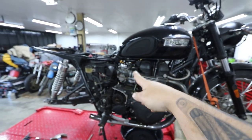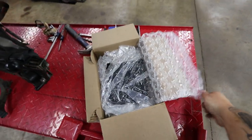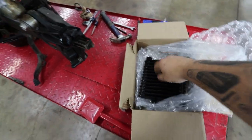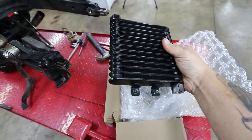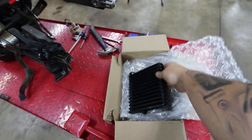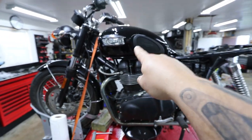I have to rip apart these carbs anyway. As I mentioned in a previous video, I sourced out a replacement oil cooler — it's used but in great condition, came off a 2013. I believe they made some improvements. I blocked off the ports and cleaned this unit and it looks damn good for being used. I did verify that this part will fit, so once I get the oil drained to the proper level we're gonna tackle the replacement.